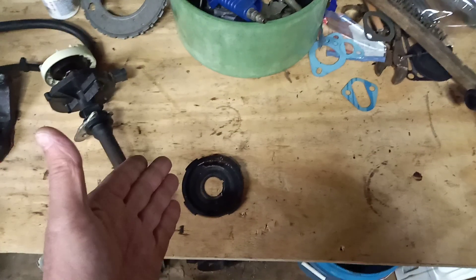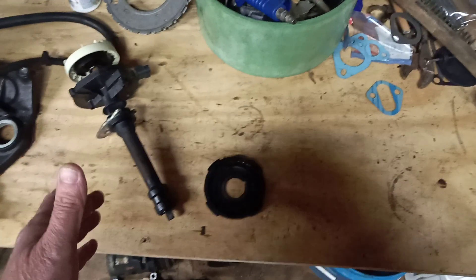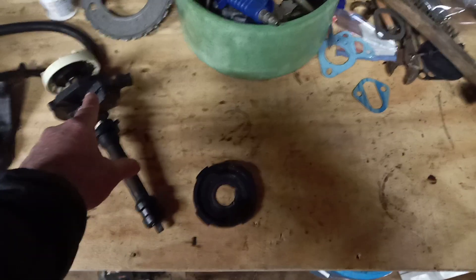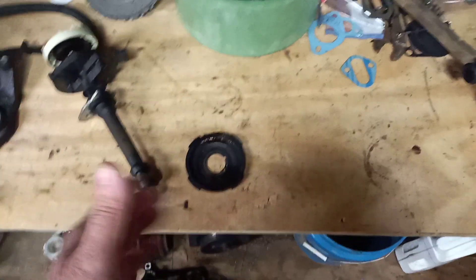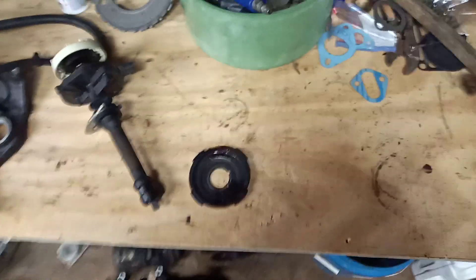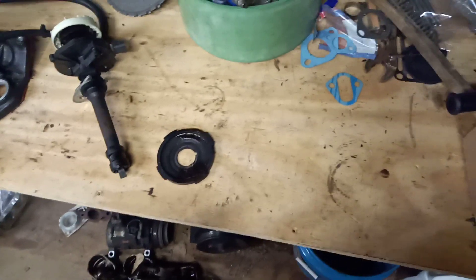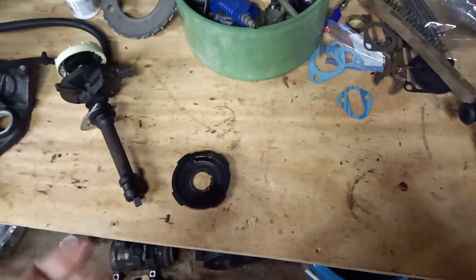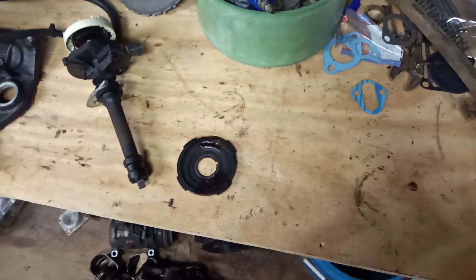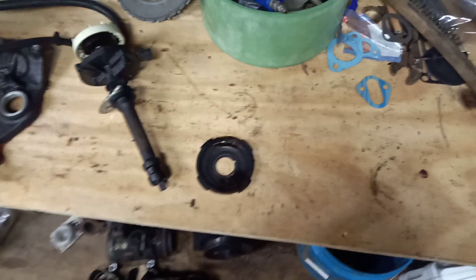Technically, fuel synchronization is either turned on or turned off by that sensor, but it doesn't affect when the injector sprays — the computer handles that. My hunch is that in the Dodge system you could disconnect the cam sensor and the system would still run, but it would revert back to batch fire mode, meaning it fires all the injectors at the same time once per revolution. You can prove this with a noid light — you pull the connector off the injector, put the noid light in, and the light flashes every time the computer tries to turn that injector on.